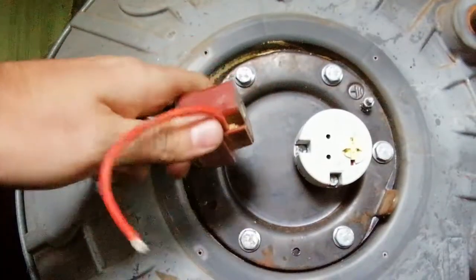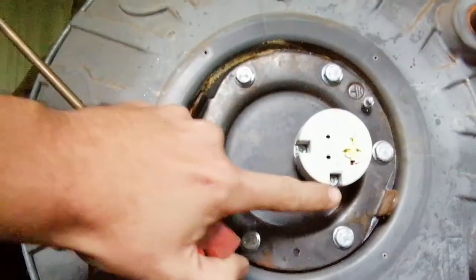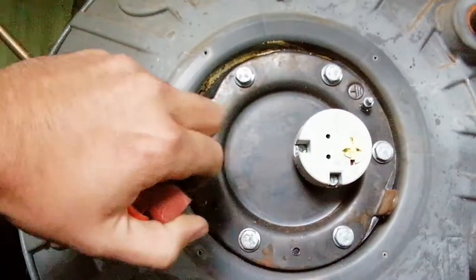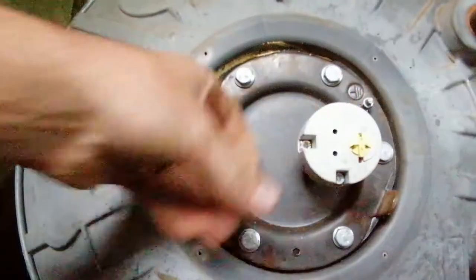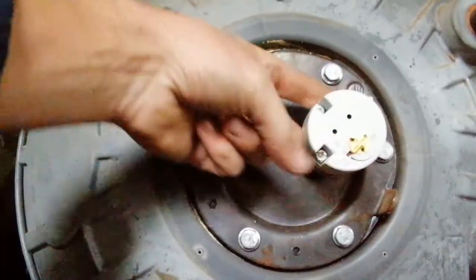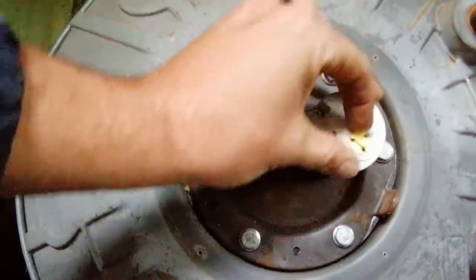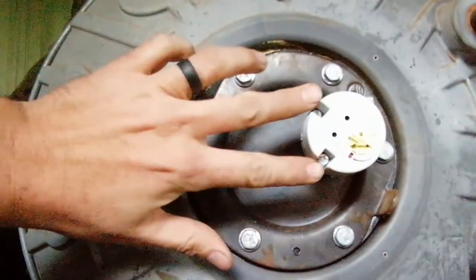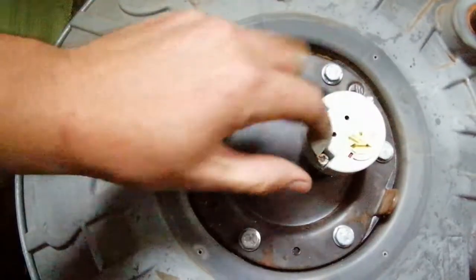The only difference is that on one type only the live wire passes through, whereas on the other both live and neutral are connected. First, make sure your incoming wire has live and neutral on there. To test the thermostat, pull it out toward you so that the two points at the back are exposed. If power is on at the input, there should be power at those back points. When you turn the dial you'll often hear a click. Turn it to off — there should be no power; turn it on — there should be power at the back.